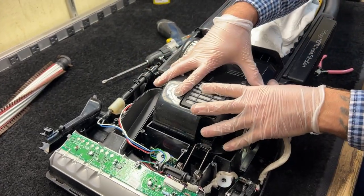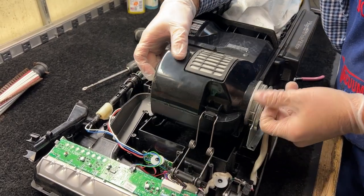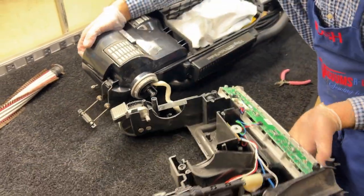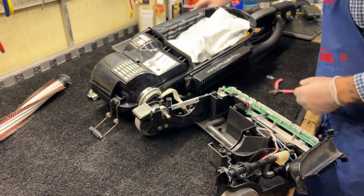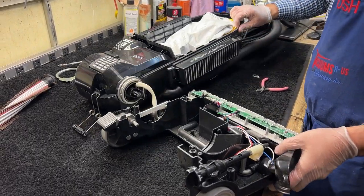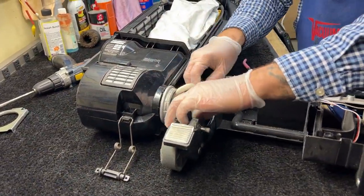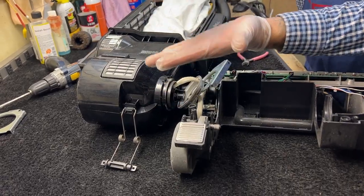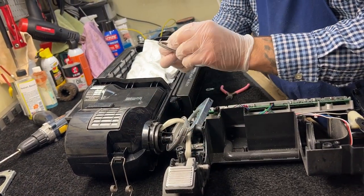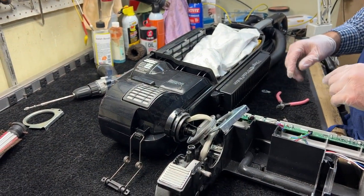I can now lift the upper housing out of the lower housing — I'm going to lift it straight up and it will pop right out. This little ring over here is going to come off and I'm going to pivot my lower housing all the way around so I now have my lower housing kind of next to it with plenty of play. There's a retaining metal retaining ring here I'm going to pop off — this is holding this clamshell together. There's another one on the other side, and also note there's a rubber gasket on this side as well — super important. I'll set this aside.